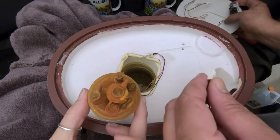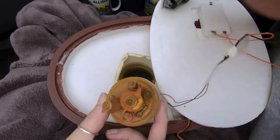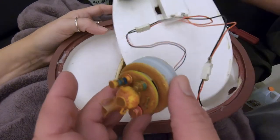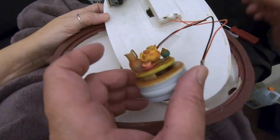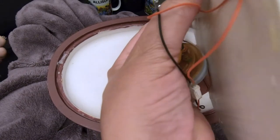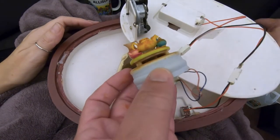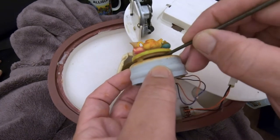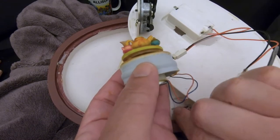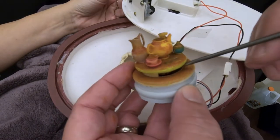It does not have a pleasant smell — that water is fermenting. Okay, we've plugged it up. Let's see what happens when I press the button. There is an impeller right here that's supposed to spin — and it's not. It's stuck. The motor's trying to spin it but it's not working. If we can get that impeller unstuck I think we can get this thing working, but the motor's trying to run the impeller and that impeller is not budging. We've got to find out what's wrong there.